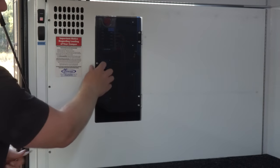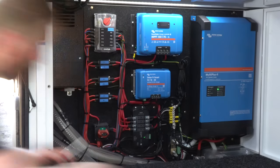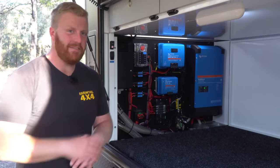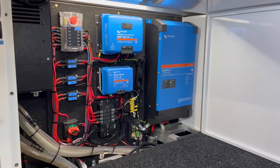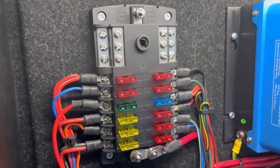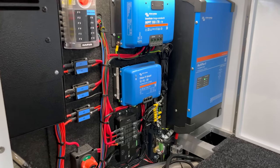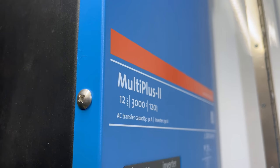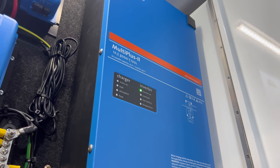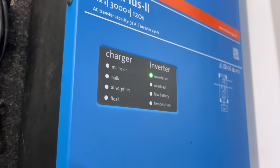Undoing the three screws on the left-hand side, this entire wall hinges to the rear of this storage section, providing full access to all of the electrical componentry installed in this setup. There is no doubt this is a seriously impressive electrical setup. With a lot of the accessories on this camper being 12-volt and the batteries also outputting 12-volt, they can be run straight through general automotive fuses — so on the left-hand side of this control panel we see all of those 12-volt accessories. But the magic in this system is the Victron MultiPlus 3KVA 240-volt inverter.